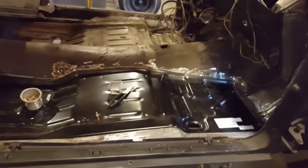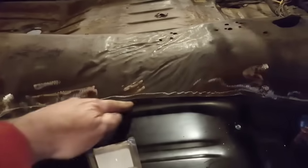So now this is all sitting good on the panel underneath. As you can see how nice the panel fits there and over here, how nice the panel fits. And we look at this over here, same thing again. Now we've got to trim it all up to get it to fit on these edges. All I'm going to do now is come up here and scribe right along this edge, all the way around, and I'm going to pull the panel out.